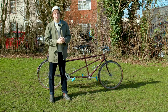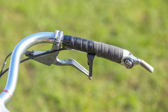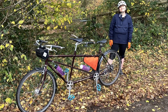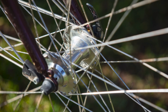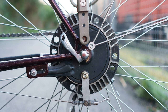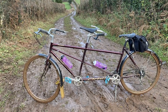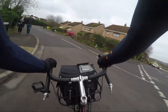As one fun little final point, there is so much flex inside this frame that I've thus far been unable to make the gears work indexed. Essentially, on the right-hand side shifter which controls the rear gears, I'm running it in friction shifting mode and just have to dial it in to the point where it doesn't skip wildly up and down the cassette whenever we stand up to climb. The wheelset is also totally brand new — I built this myself with a set of DCR 40-hole hubs with matching Sunringle Rhyno Lite rims. On the rear we also have an Arai drum brake which I sent off to get refurbished. It uses basically glued-on brake shoes which have to be cooked in an oven or something — not the sort of thing you can do at home. I think it's the heaviest wheelset I've ever handled — something like four and a half to five kilos for both wheels with the drum brake fitted, which given we feature bikes that weigh that, gives you an indication of just how much this bad boy weighs.